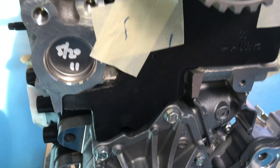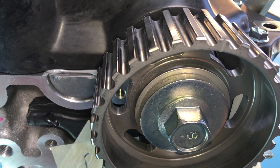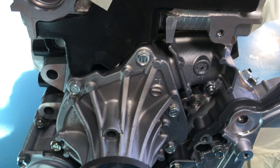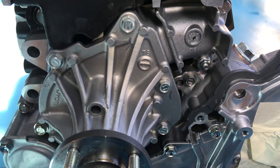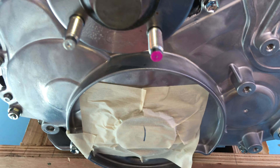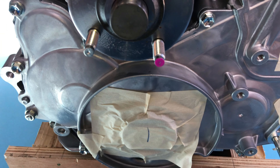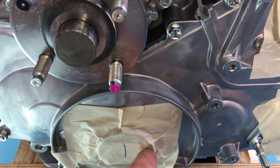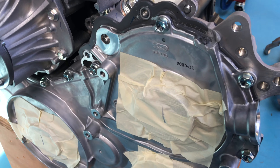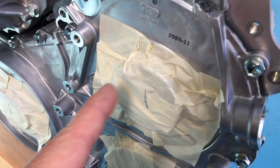Working our way round, over the front here - obviously we need to take the cam gear off and put the plastic backing plate in there. They no longer come with that. The water pump's on there, which is really good. You have to swap over the crank sensor which goes in a hole just down here. So the harmonic balancer has to come off the other engine and get installed here; the seal will be already installed behind there.